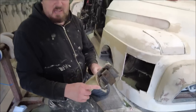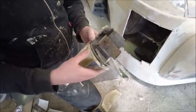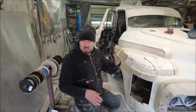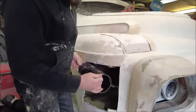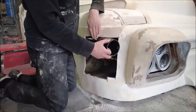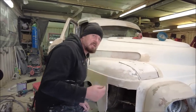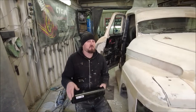That was pretty tough to get through - I had to cut through the end of the original bumper iron, the plastic, and then this overly thick piece of fiberglass which is really, really strong. We're looking at probably about 20mm thick - it's super strong around the front of this car, but that's what we've got to do. Now I'm going to mount these pipes in here; I'll probably still have to take a bit off inside, but I want them pointing nice and forward. Then I'll chamfer them back in line with the body line so we'll have like two teardrops up there, perfectly frenched into the body, and we'll put something in those as an extra detail to help get much-needed air into this car.